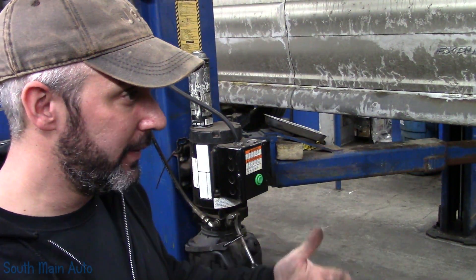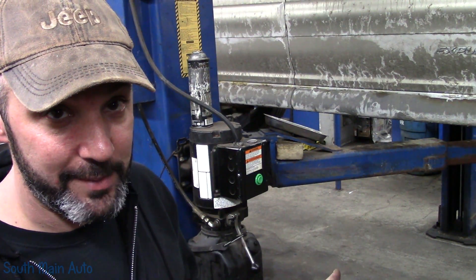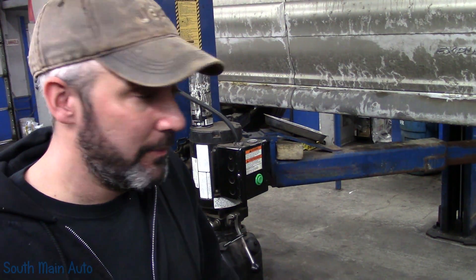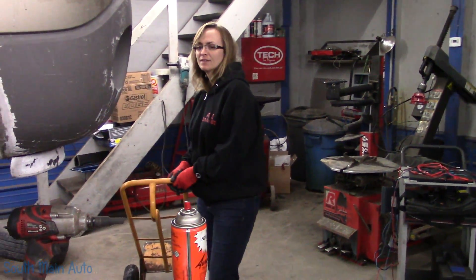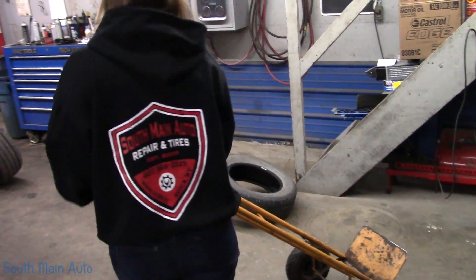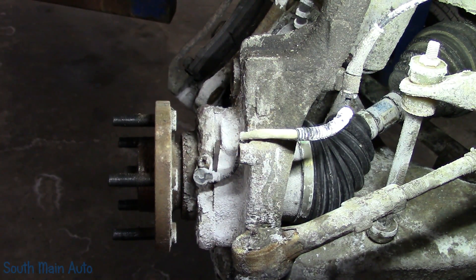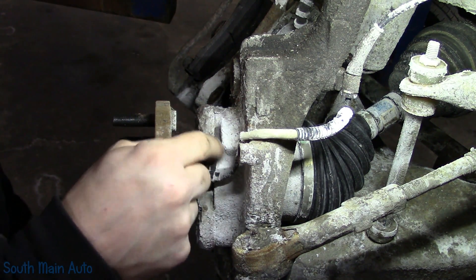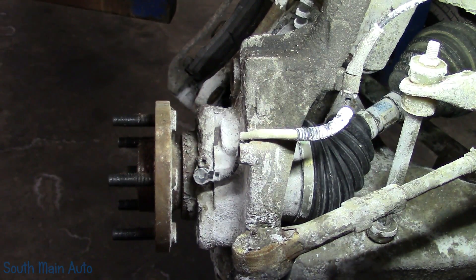When there is no offset and you spin the wheels — which is in the file linked below — the AC sine wave from this wheel versus the other is almost identical. Why doesn't the ABS module like it? I don't know. We are down to the meat and potatoes now. As you can see, all the goodness — the white crusty stuff — is all over the sensor. Salt is highly conductive. We know the sensor is functioning, but not acceptable.